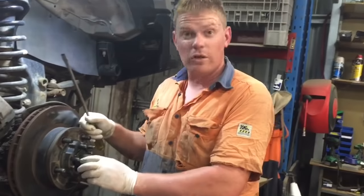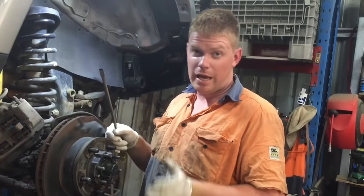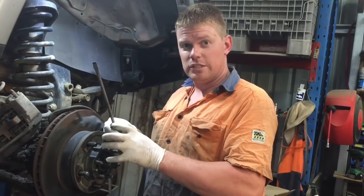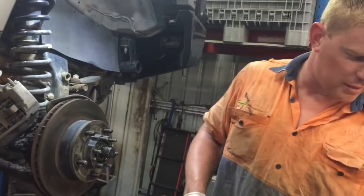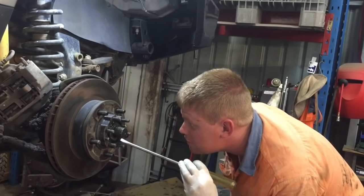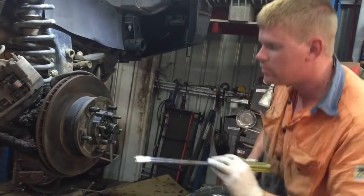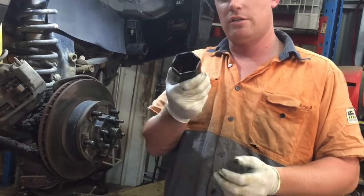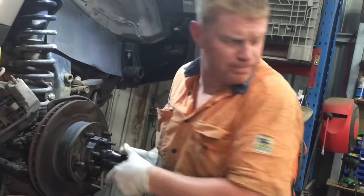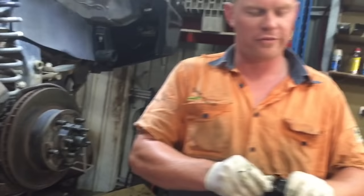You can't have too many spare gaskets. The washer will fold over the first lock nut and back over the second lock nut. There's little convex sections in the spindle which the lock nut locks into to stop it from spinning, which locks everything together. So what you do is find where your tab is, give it a tap, try and bend it over. Get your tool — I think it's a 54mm socket. They're relatively cheap from your local four-wheel drive enthusiast shop.